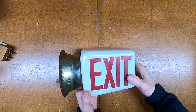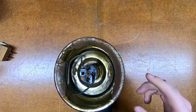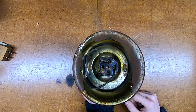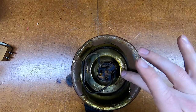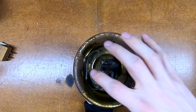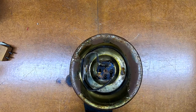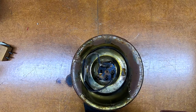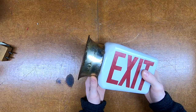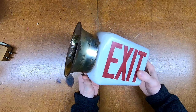I set up a push button system for toggling on and off - I actually wound up making a very tiny latching relay circuit, basically a D flip-flop to make it work. It turned out really good but I did not have a lot of space in the base. This one is quite a bit bigger. One of the issues is the same I had with the other one: the mounting screws are in the bottom and my electronics have to go in that area, the LEDs have to go through the center. I used a backing plate over this to cover everything up and give the electronics somewhere to mount to.